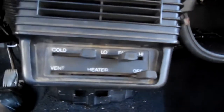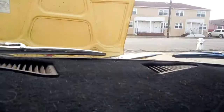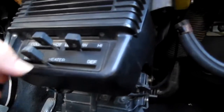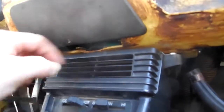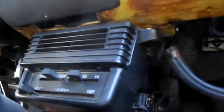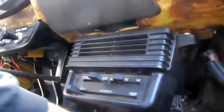And it's strictly from up here. So then defrost — the air comes out the top, or it's supposed to. When it's on heater, the flap closes down. When it's on vent, it blows all that crap out of there because I didn't use that. With it on vent, I don't feel any air coming out.